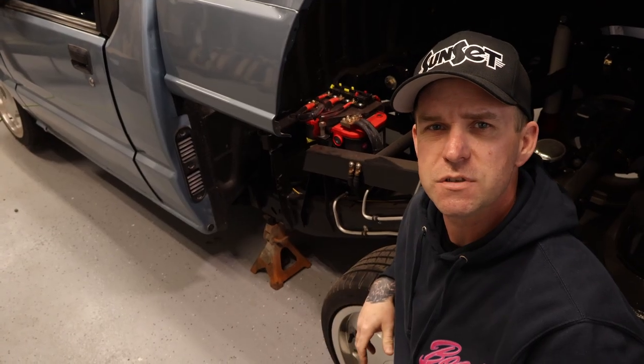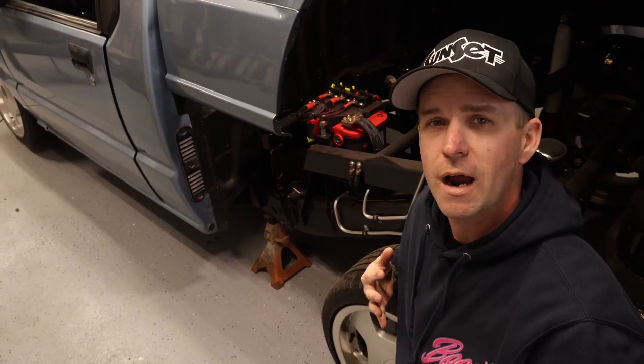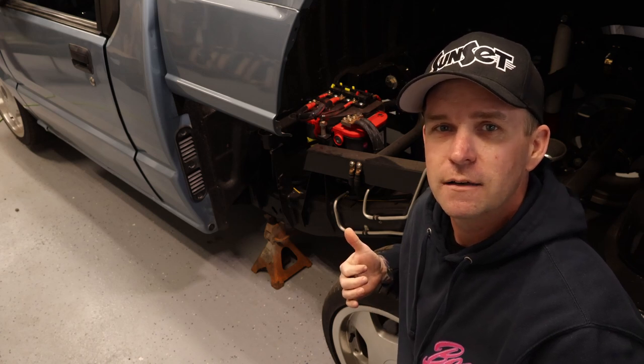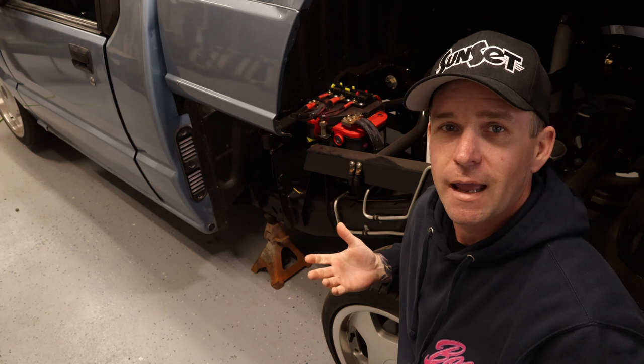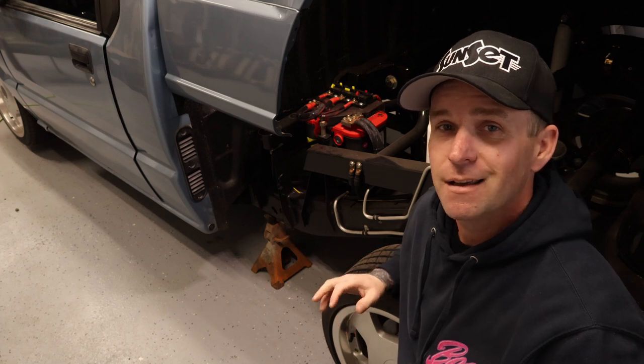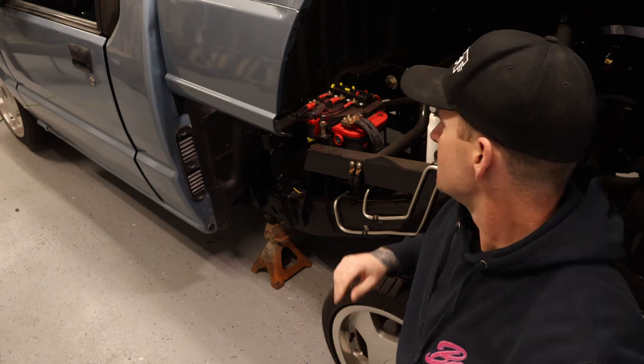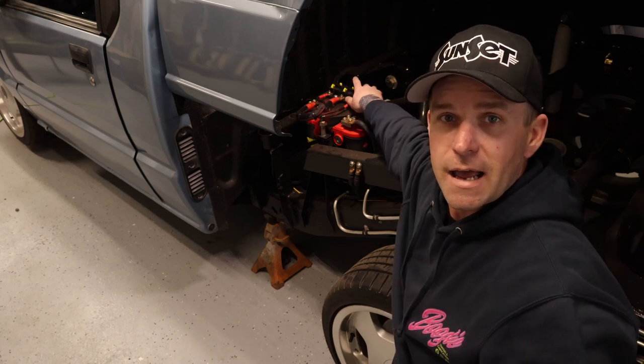Not a lot of people like using fuses to protect all their wiring, but here's why I like breakers. If I make a bonehead move and ground a hot wire, all I got to do is reset the breaker. And anytime I'm working on something and I'm not being a bonehead, I can just disconnect the breaker like this. How hard is that?